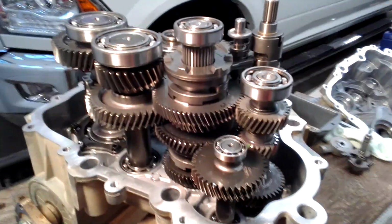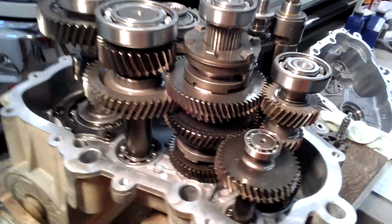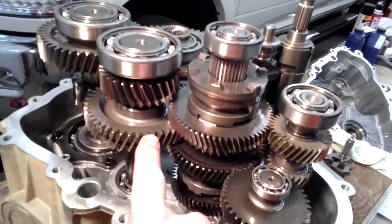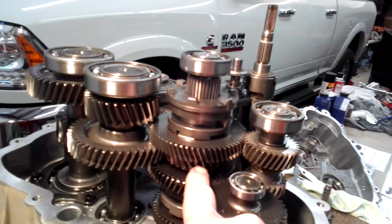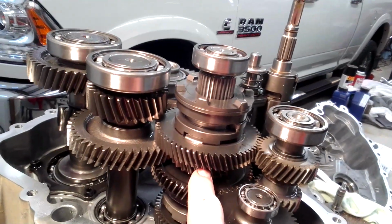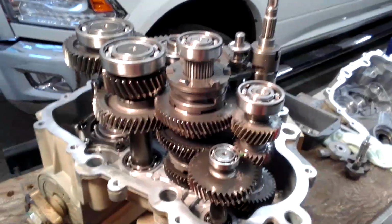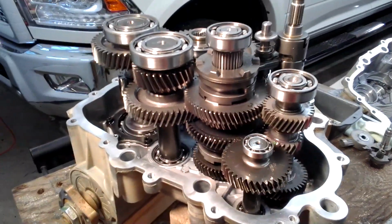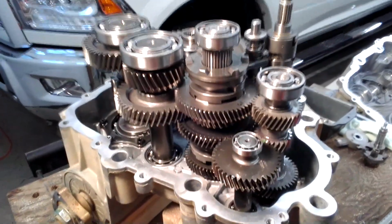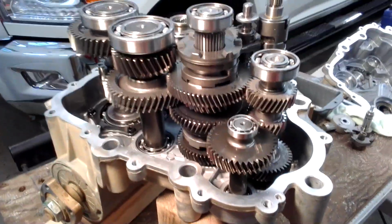Let's see, I'm going to go to the 325 Ace, they call it, lowest gear reduction. It'll be this gear and this gear right here, which is all on what they call the reverse shaft. It's built onto it, so the whole shaft has to be replaced. This is the gear reduction you see Super ATV sells. Turner sells it. I think Super ATV's is almost $500 and Turner's is like $650 for it.